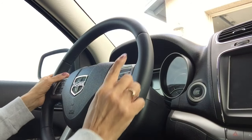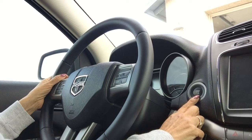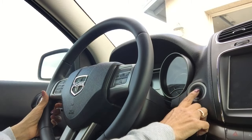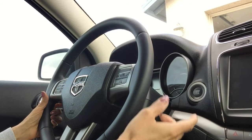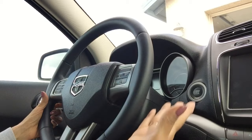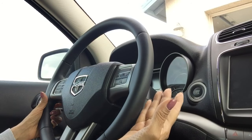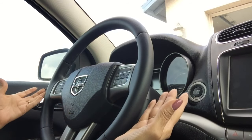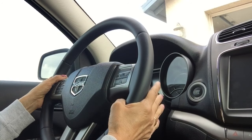A lot of people suggest: if you have the keyless starter and your car won't start and you're sure it's not the battery, go ahead and hit it five times, let everything reset, put your foot on the brake, and try starting it up. That has worked for me in the past, but this time it didn't. Last time when I replaced the battery, charging it up also worked, so that might be another thing that helps.